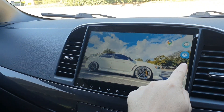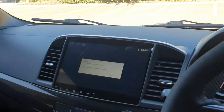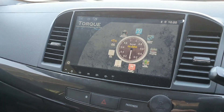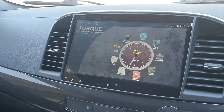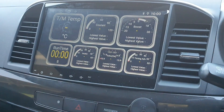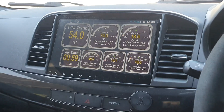This morning I had an issue with the EX gauge not displaying any data. I did some quick research and found that for some reason the gauge just seems to drop out or lose connection — you've got to actually add the predefined set PID. Let's see how it goes — connected, got revs, go to real time, and there you go.